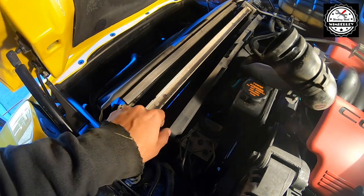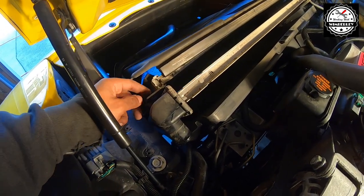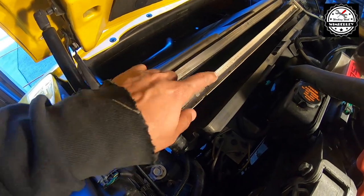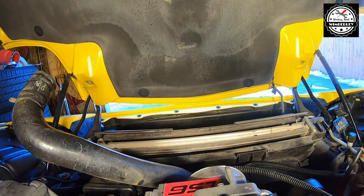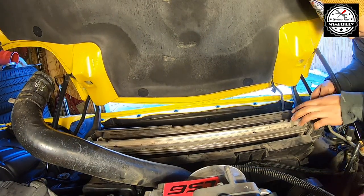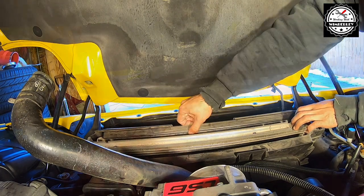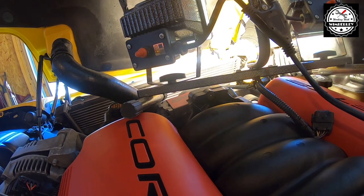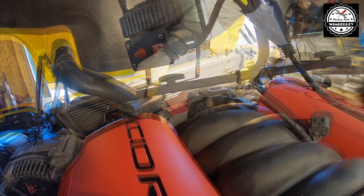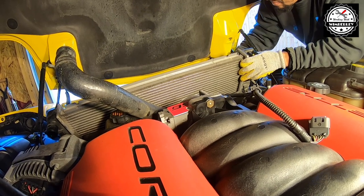The cooling fans are loose and there's a condenser clipped on the front. If I can just lift this up and out of the way I think I can get the radiator out. The radiator fits into a slot on each end — it's not bolted in at all. I had to wiggle it back and forth from each side, making sure it cleared everything, and eventually I was able to remove the radiator.